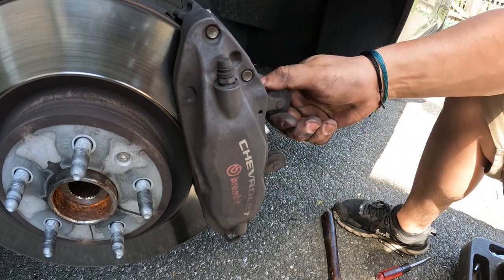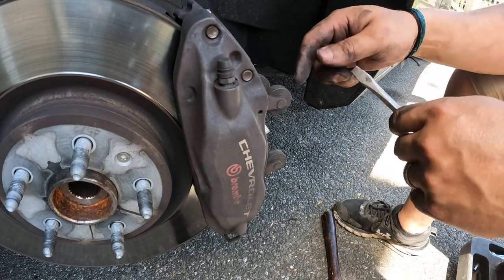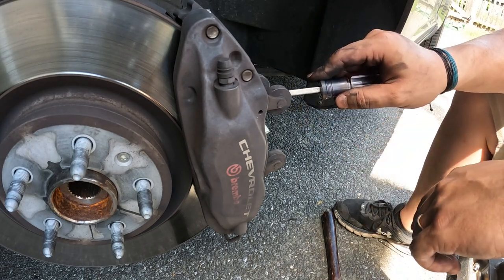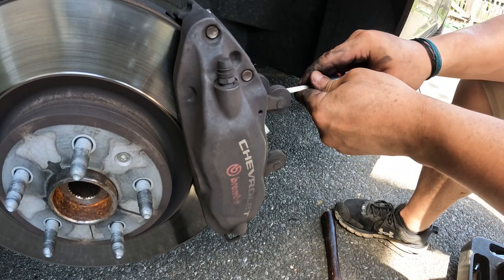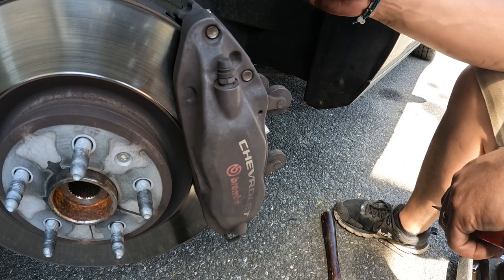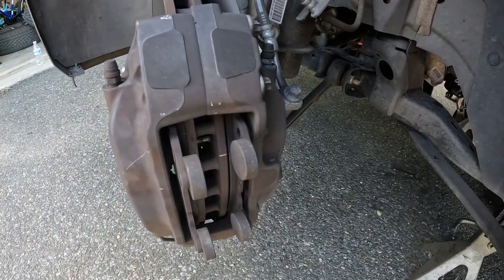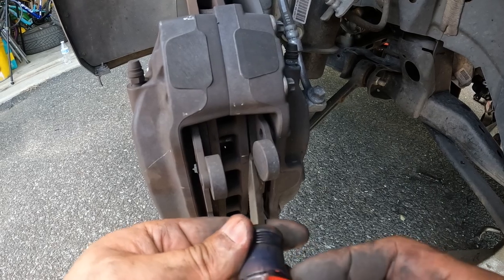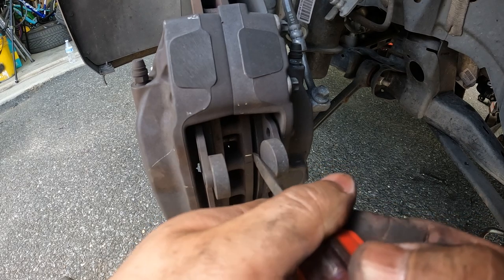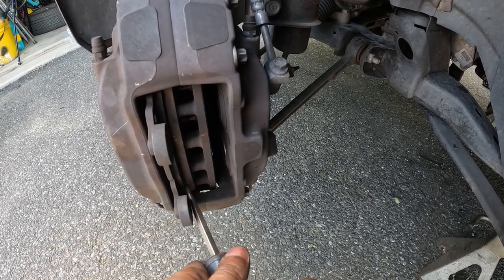If your pads don't just come out, that's okay — don't freak out. These circles right here: get a flat head, put the tip on the edge of the rotor, and use this circle as leverage — just hit it right there, grab the edge of the rotor and push back. Normally I'd tell you to connect some hoses and crack these bleeders to get the old fluid out, but we're doing a complete flush so that's not an issue. Get your screwdriver, put it right here, use that as a leverage point, and retract the pad.